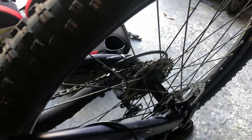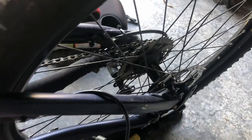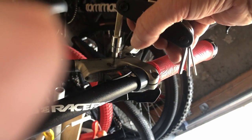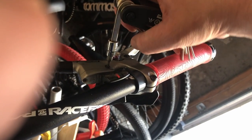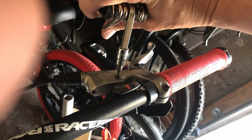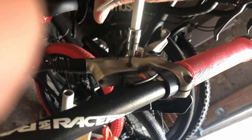I put a clamp on it and you can see it squeezed them in. Then what you do is you get a bunch of pressure on those and you go to your hydraulic bleeder and you open it up a little bit, wait until a little bit of fluid starts to come out.